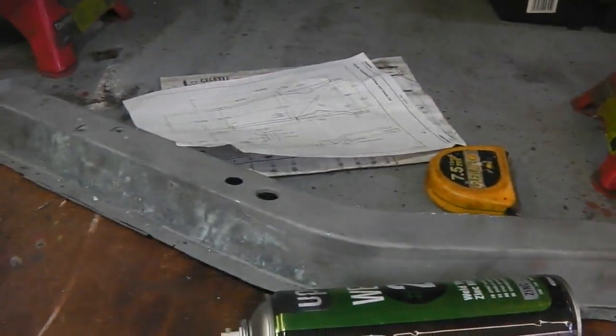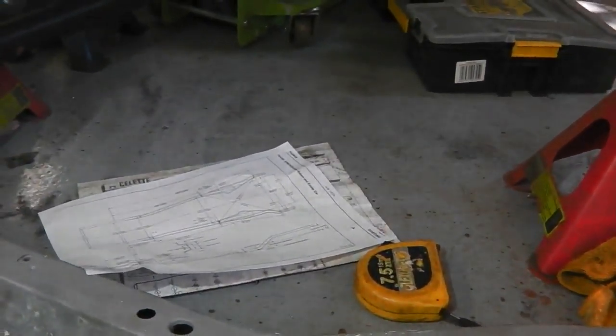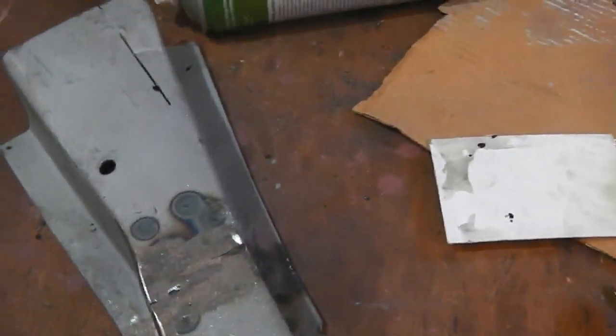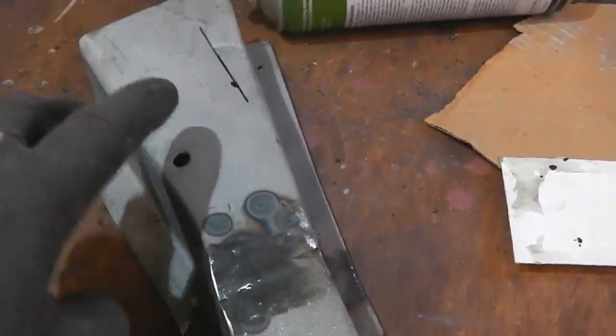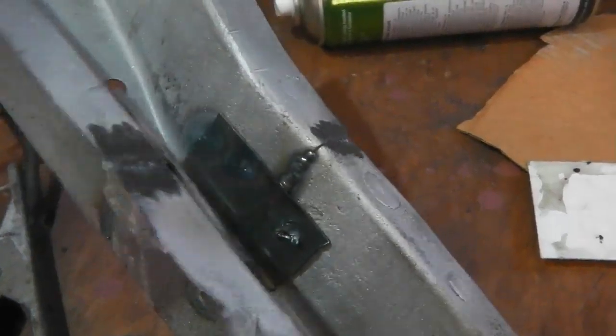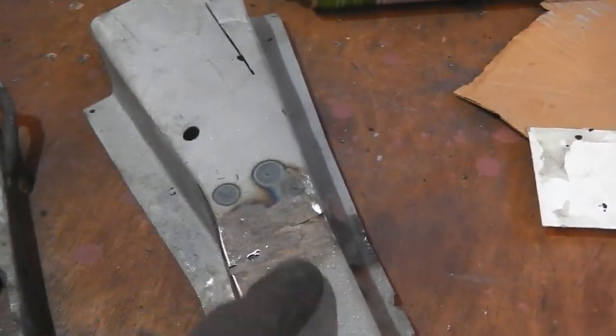Got that up and the chassis legs up, and I've got some frame dimensions here. I think we've discussed these frame dimensions in earlier videos. They're really handy, and it might be easy for us to have both the outer boot floor legs actually in place, just to check these frame dimensions, because it is part of the frame, it's classed as the frame. So what I'm doing is I'm repairing the last chassis leg with a good piece off a scrap car. Remember, the Bramble's original leg, this end was damaged, so a new end's been grafted in, everything shot blasted back, some plates were spot welded at the back there, then I've infilled with weld. I didn't want to just do a butt weld there because it's a stress point, so I've put extra plates on it to give it a brace.